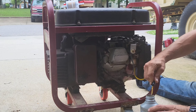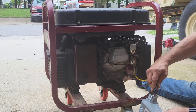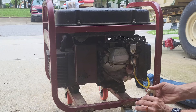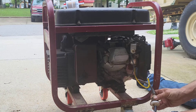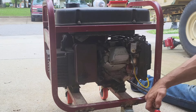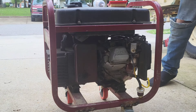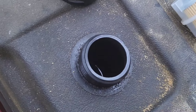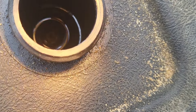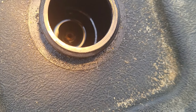Now it probably won't be pretty, but these are the kinds of things you have to do when parts are hard to find on these older units. I'm going to drain this gas first — take it right out of the line that goes to the carburetor. It goes down and around to looks like here. And that's some nasty fuel. That's pretty gross. Starting to clear up — felt like it had a bunch of garbage in it. I'm going to wipe that fuel out of there to get this tank as dry as I can.